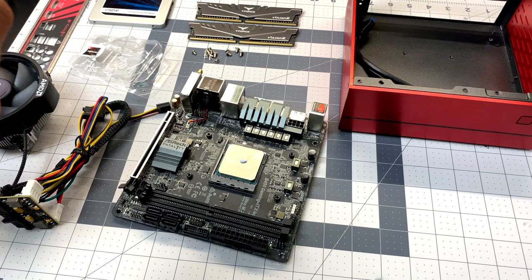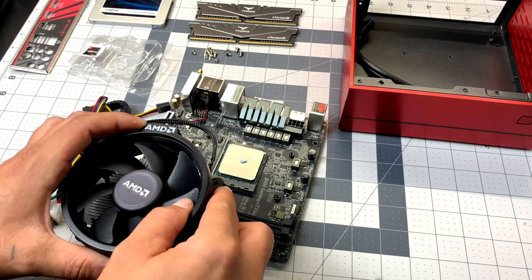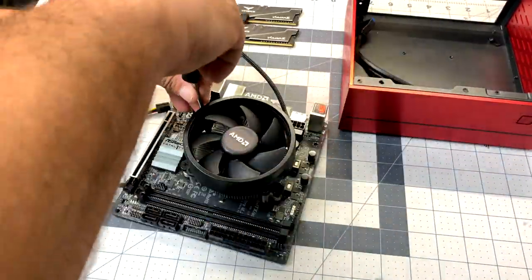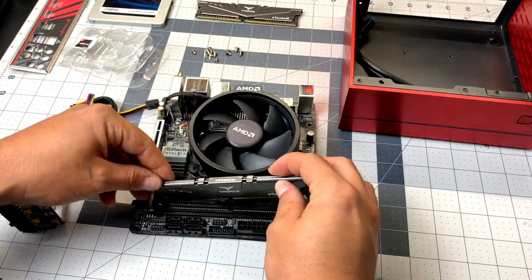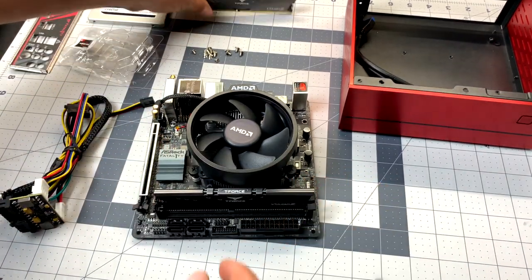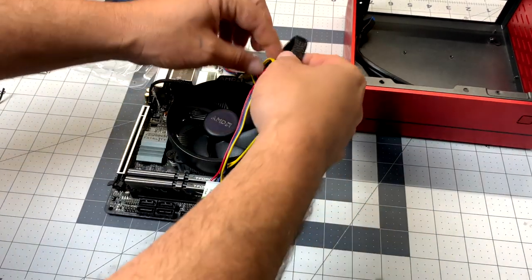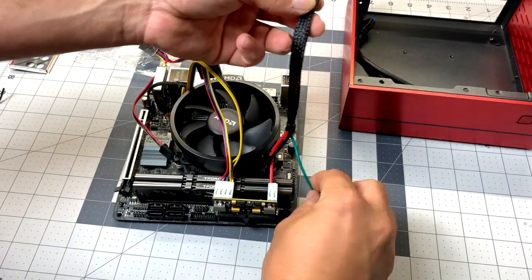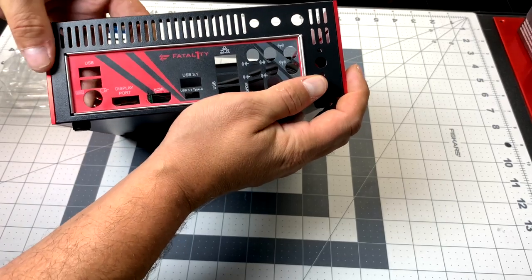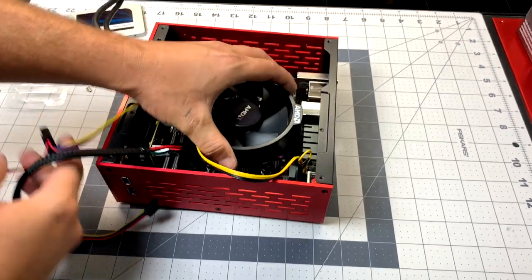As for the build, it's pretty easy. It's tight in this case, but if you've ever put a PC together before you could knock this out in under 20 minutes. One thing to note with this motherboard and Pico PSU — it does sit over the RAM, so you want to make sure you have low-profile RAM. This TeamForce Vulcan Z works perfectly. The power supply fits right in there and does clear the RAM. With most Pico power supplies there's a ground connector — I connect it to the closest motherboard mounting hole. Don't forget your I/O shield, and if you're using an M.2 drive, make sure you connect it to the motherboard before putting everything in.